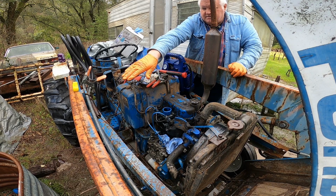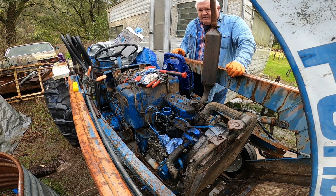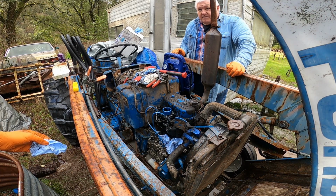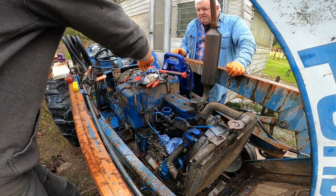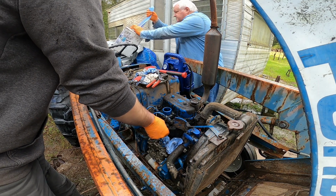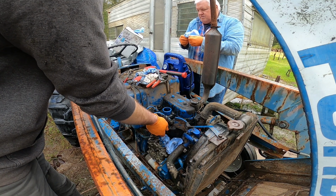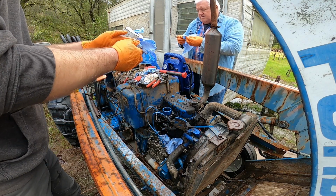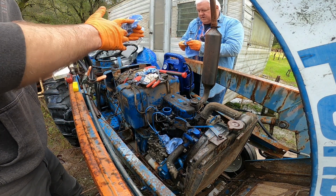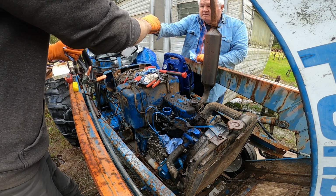Now, on the inside is all the gray matter. It came out the inside of the boom there. Yeah, we'll see. Here, let's, what do you need? Thinking I'll just pop these glow plugs in back quick and dry them off. Give it a sniff of ether. Let's see if she wants to light. It's actually pretty clean. I don't think there was too much in the cylinders. We just kind of walked it all out of there.